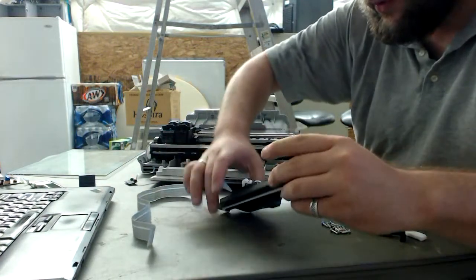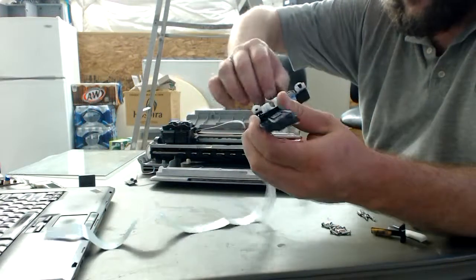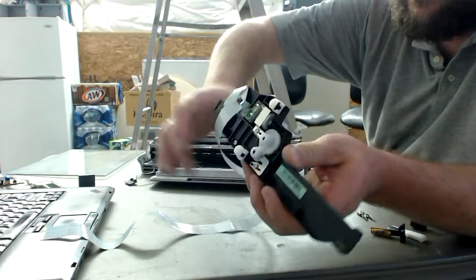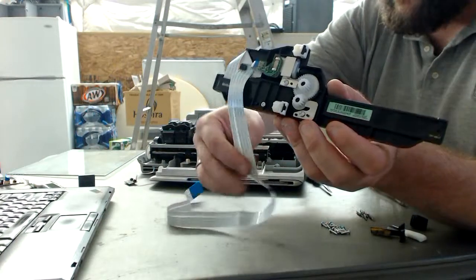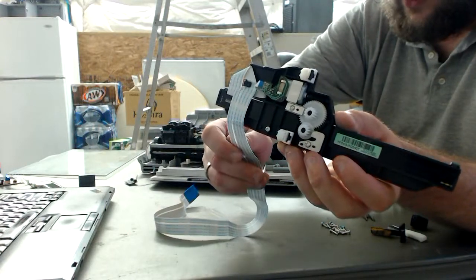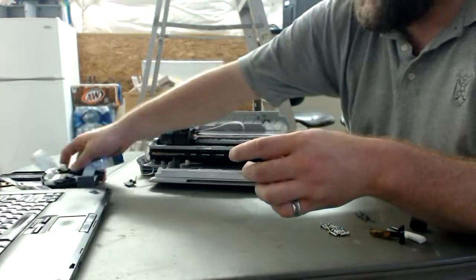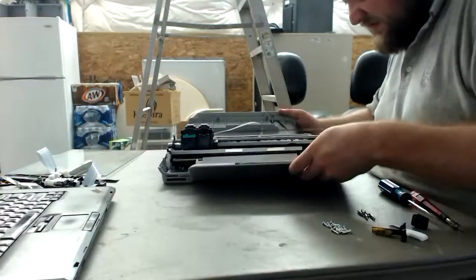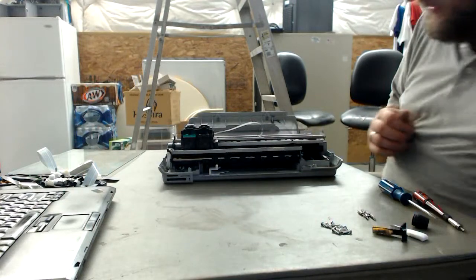Okay, and we have this really cool assembly right here that we could easily hack and work around. It looks like there's an optical encoder for counting how much this thing turns. I mean, this thing is a pretty nice little harness. And I'm guessing when you look at the lines here, there's 5 traces on this side and a bunch of traces on this side. I bet you this is the motor control side and power. This is data. So cool, that's a later on thing. Nice circuit so far. What we're going for is motors. So, more plastic junk. Big surprise.